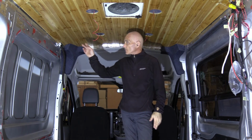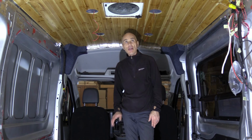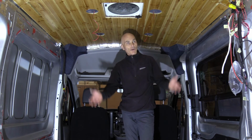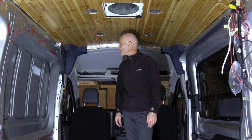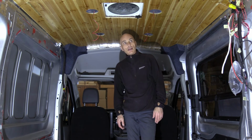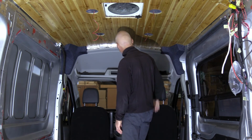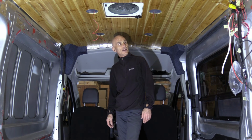I applied 2 coats to the dry spots, the whitish spots after sanding, and that took care of that. And then after all of that was dry, I applied a 3rd coat as recommended by the varnish manufacturer over the whole ceiling so that everything would be as good as possible. And it's drying right now. It's dry to the touch, and yeah, it looks good. And I took the drop sheet off. The blobs are okay. They didn't get stained or anything. Haha, it can happen. So yeah, quite satisfied with the way it looks.